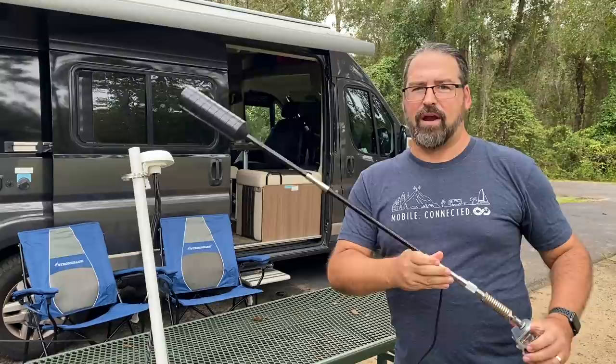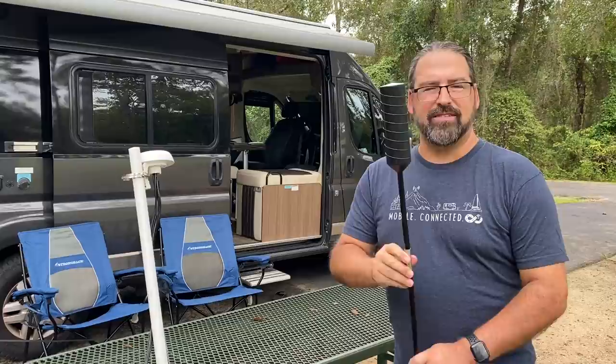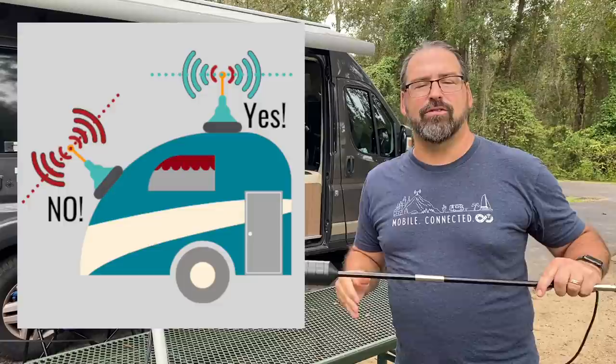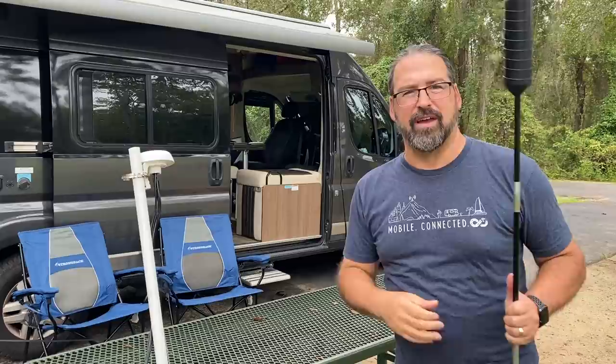Your cellular or Wi-Fi antennas can actually go along for the ride on a batwing. When you stop and crank up the antenna, up it goes. When you crank it down, it's nice and flat and won't hit any trees. But something very important to remember: antennas have an 'up' to them. An antenna lying flat will have its signal bouncing down and straight up — not going to the places you need it. An antenna really needs to be upright to work, so don't expect it to work when stopped unless you crank it up.